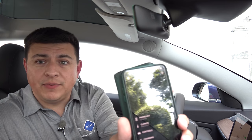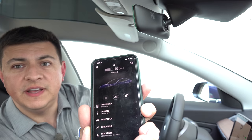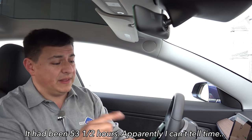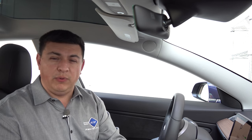To highlight this, we can take a look at our app right here. You can see I have 163 miles of range. When we started this experiment, I had 222 miles of range according to the car, and it's actually been about 50-some odd hours now — we probably crested over 60 actually by the time we're recording this video. Still again, about 1.1 to 1.15 miles of loss in terms of range per hour that sentry mode is on.